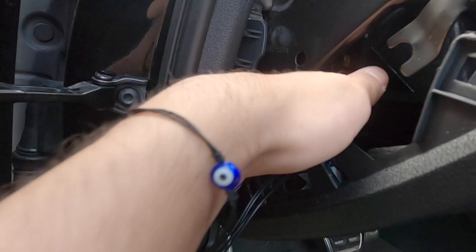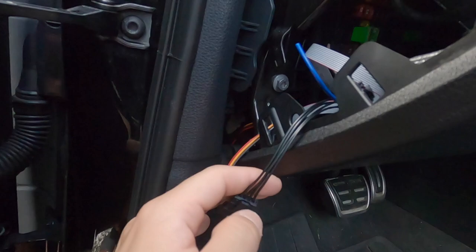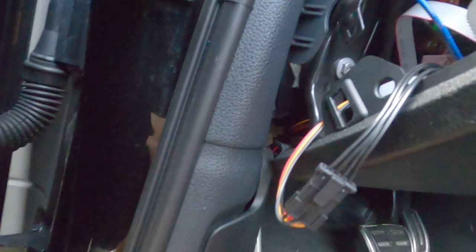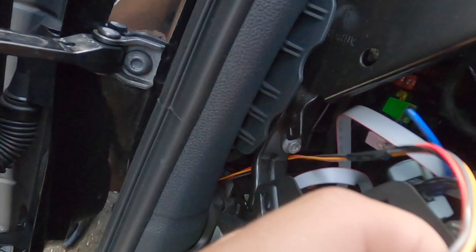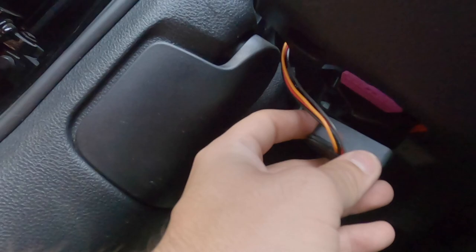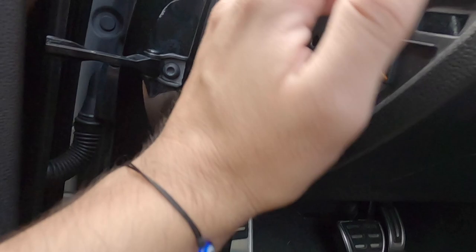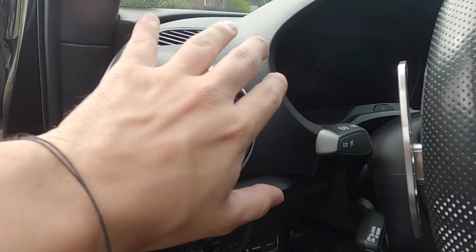Here's how I ended up routing everything: the control box sits behind the panel so nothing interferes. I disconnected the harness in the middle and ran the wire through a little hole back there to keep everything hidden. You can pull it up from here and you won't see anything. The OBD connection tucks up right in there and the panel hides all of the wires. Now I'll push the gauge all the way in.